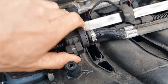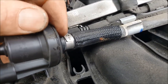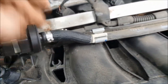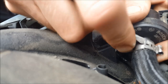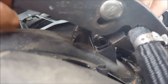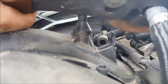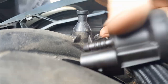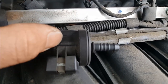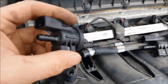To replace it — super easy. Pop it up off of this pedestal, spin it, and get a pocket screwdriver underneath the clip. You can actually reuse these clips, but I'm going to replace mine. Then slide that back, put your slip joints on there, lightly squeeze down, and wiggle that hose loose without ripping it. Note that there's an arrow on the valve showing which direction the purge flow goes, so it goes back on in the same orientation.